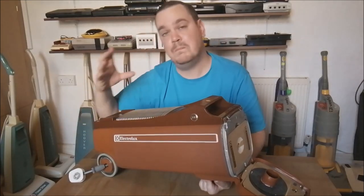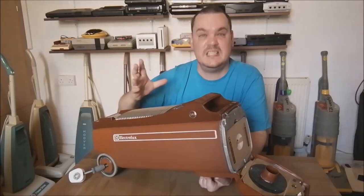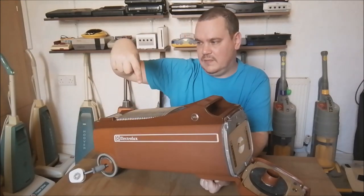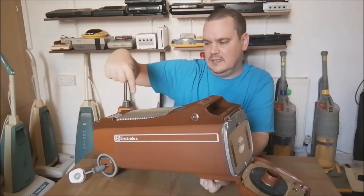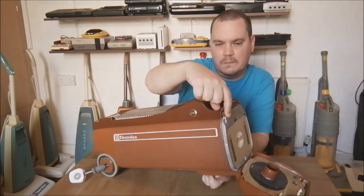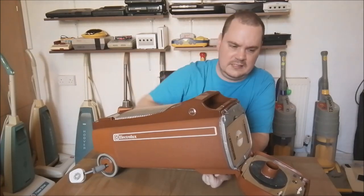And at this point, mounted on the rear motor bracing plate is a micro switch. And this rod comes around and it bends round, and then this little rubber pusher moves back and forth. Now I think if the switch is open, the machine will run. If the switch is closed, the machine will stop. And that's the key bit.